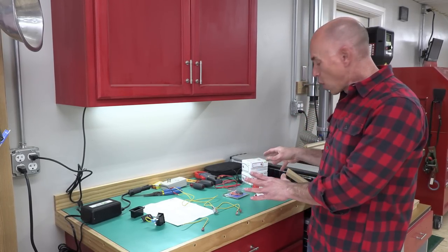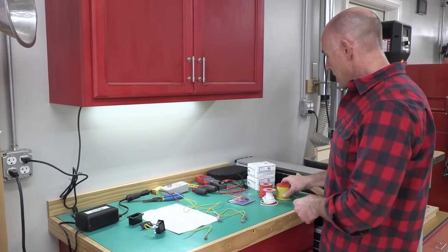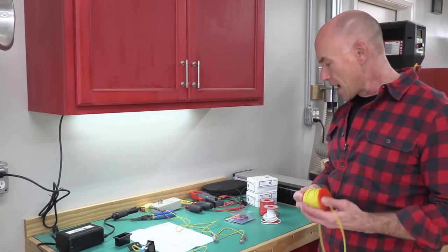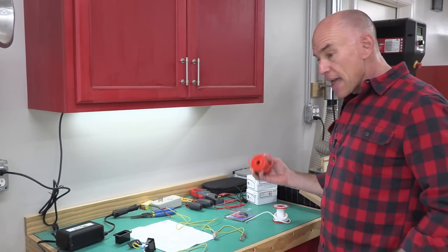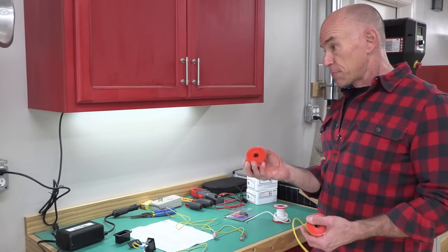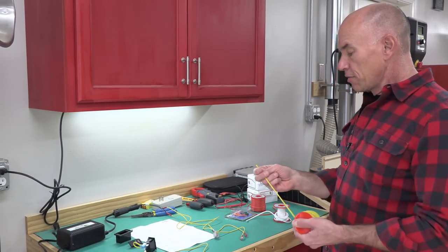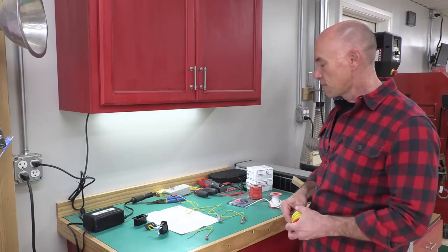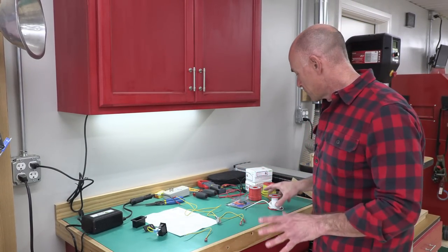First, I'm going to need some wire, obviously, and I will need to run three wires to make this work. Since this is a Winnebago, I've got yellow, that'll be our hot. The neutral will be white, and red will be the switched power that goes back to the pump. That's our load. And all of these are 14 gauge wire. The pump has a 10 amp switch, so 14 gauge wire should be able to handle 15 amps, so we're fine there. So that's those.